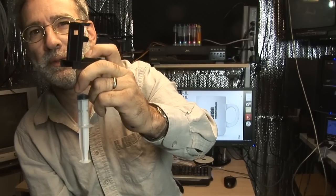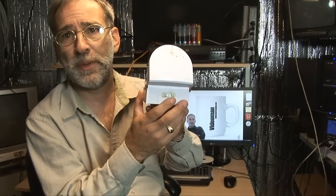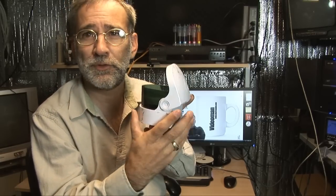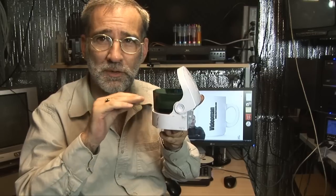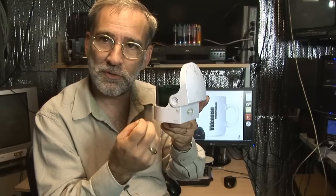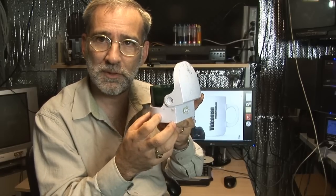Another thing that really works — and nobody seems to know about it — is hairspray. Or for the really obscure, a dental ultrasonic cleaner. I got one for $12 off eBay. Fill it with a little bit of water, drop the cartridge in just enough to cover the bottom, and the vibrations break up the ink clog at the bottom. Awesome.